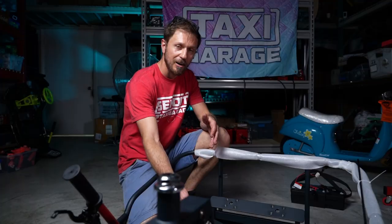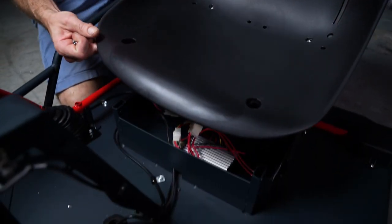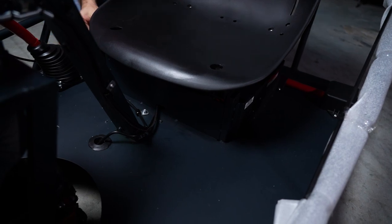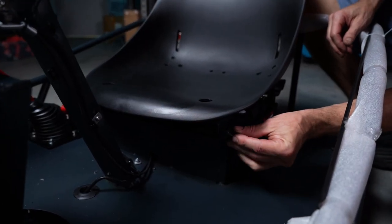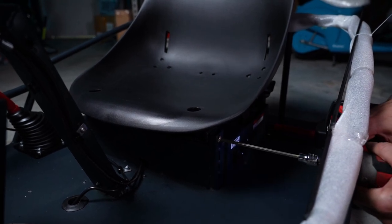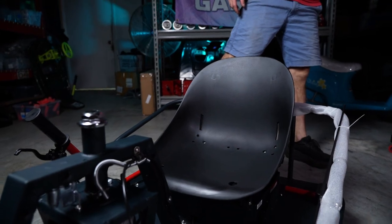Step 14: we're almost done — just reinstall the motor harness clip, factory seat, and factory steering wheel. Take your motor harness plug and reconnect the yellow and blue wire connector. Put the seat back on, clip it into the back swivel hinge points, and hand-thread the two 5mm bolts through the front holes. Use the extended 5mm Allen key on the gun for easier access, snug both sides up, and confirm the seat operates properly.